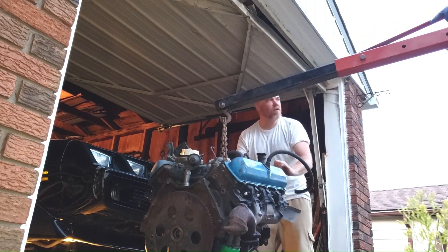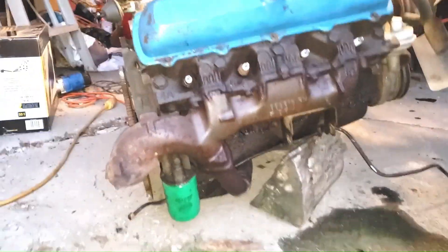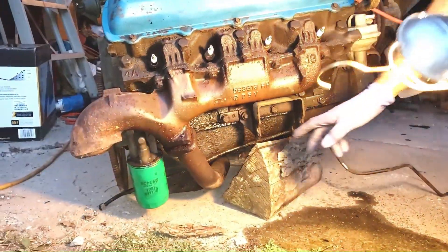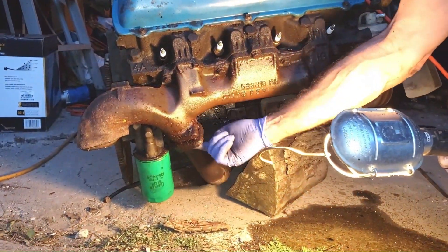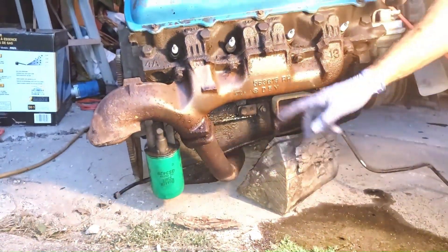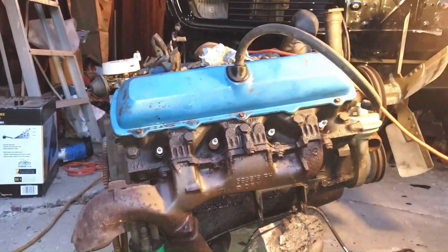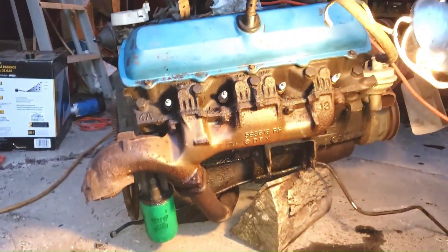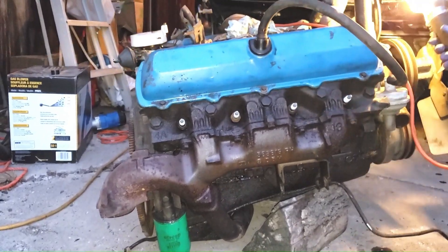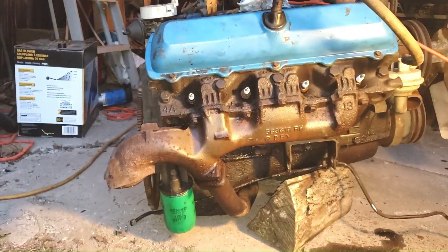Oh, we hit the car — that was a lot too early. Now the engine is out, and this is the exhaust pipe I was trying to undo. Turned out, all I had to undo was this one side here, because that's your crossover, and then it goes single pipe down the back. I'm going to take it apart a little bit before we send it to the rebuilder — I want to make sure that my diagnosis is right inside, what's wrong with it. But for now, we're going to call it a night.